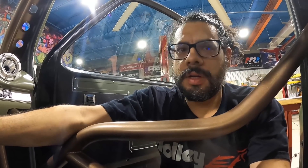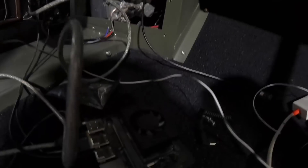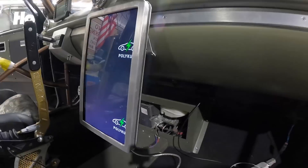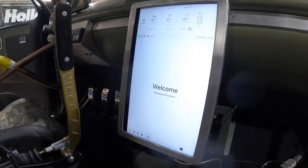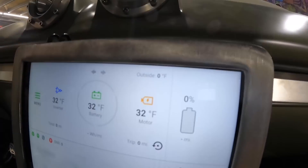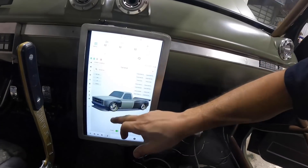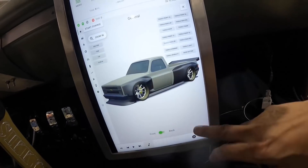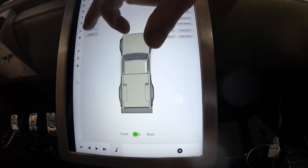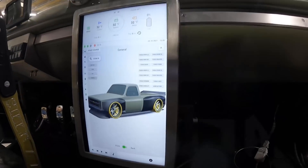Our MCU from Polycup is going to be doing a lot of things. It's going to be a display unit — as you can see it's powering up right now. It does have a small processor. What this is going to do is have a CAN bus interface and will be able to stream all the data from our BMS system, the motors, and hopefully eventually we'll be able to input data instead of just receiving it. We have a screen that's going to display our battery state of charge, motor temperature, battery temperature, inverter temperature, as well as navigation — so it's a pretty integrated piece of electronics. We also have an awesome display of our truck on here, we can show different features on the truck, and as time goes on we'll be able to connect lights in here and see them turn on in the display.